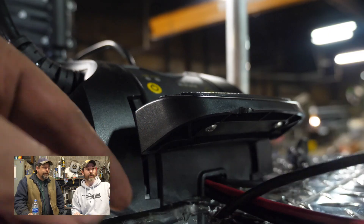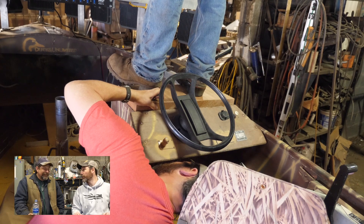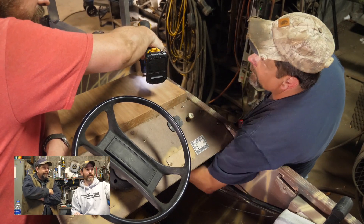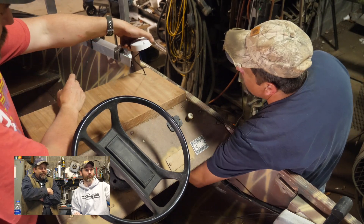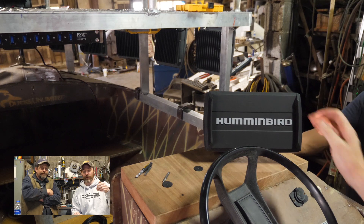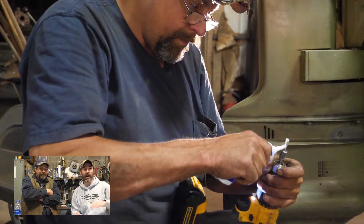You route those wires down through the deck to the batteries. It's a GPS-controlled trolling motor. Here we're putting in the GPS unit — that's actually the GPS beacon, which figures out the direction of the boat relative to actual coordinates. That's the unit itself, and you can set it up so that if the fish are in 10 feet of water you can autopilot it — the motor will know to hover along that 10-foot contour line. Pretty awesome.